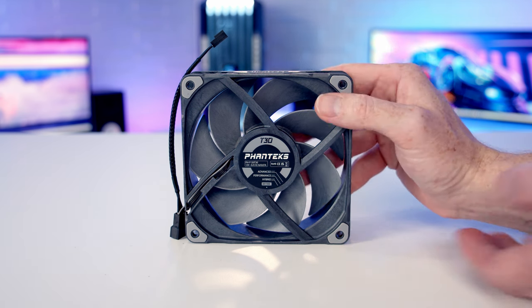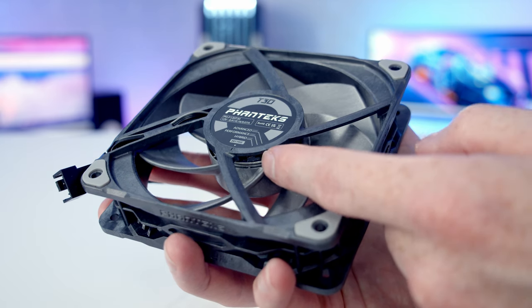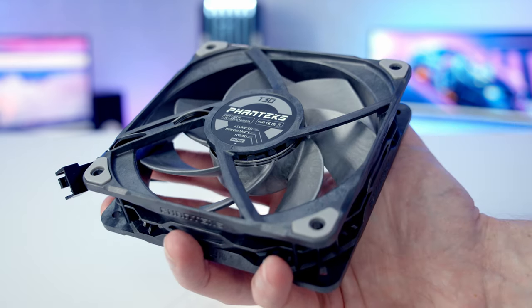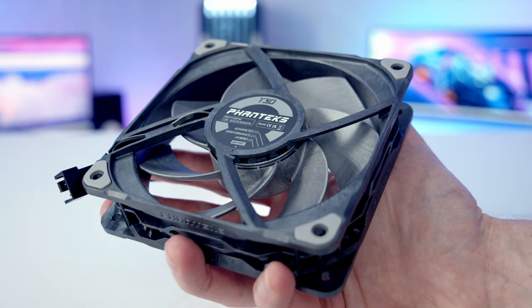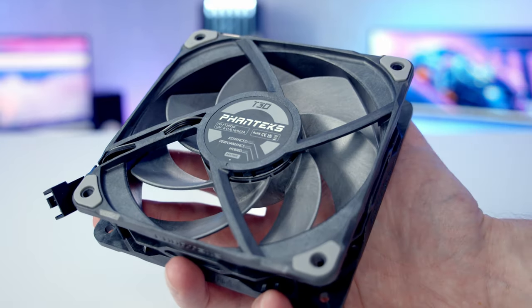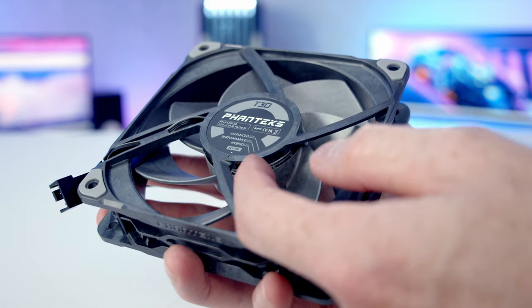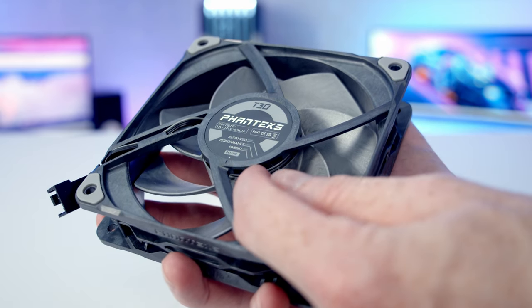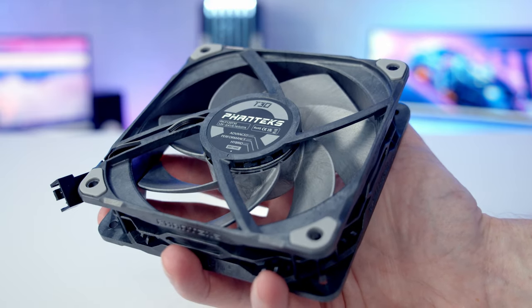If you do want to adjust it, you can see there's a little lever here, and this is what is actually going to adjust the fan speeds. So if we pull the lever this way, that's it moved over towards advanced, where the fans will run at the fastest speed but bring the most noise. Push it all the way over two settings this way to hybrid, it's going to run the slowest but also give us the lowest noise. And the one I'm going to go for is the one in the middle, which is performance. So I'm going to leave all the fans set to performance.